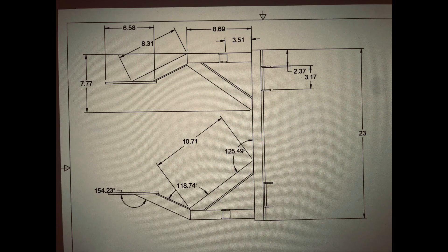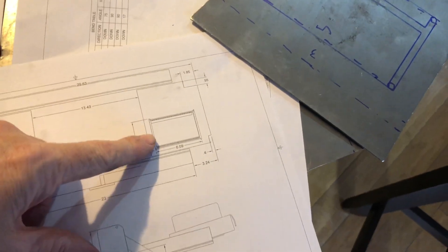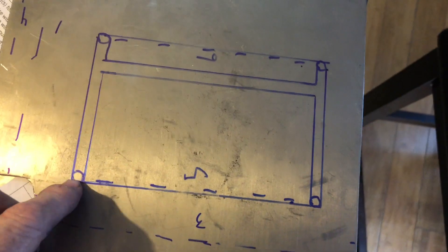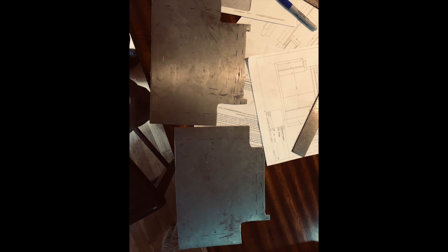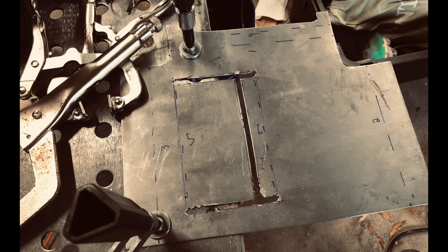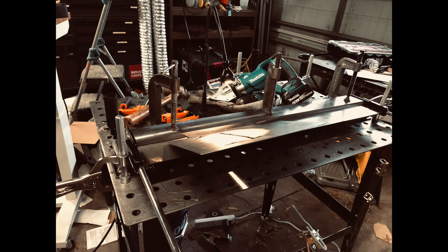Now I'm working on the rear harness for the OneWheel. In order to make the OneWheel pedal work, I've got to cut a hole out of this plate. I'm going to chain a couple of drill holes here and here. Using sheet metal I got from Home Depot or Lowe's and a metal cutting shear, I was able to cut the slots out for the front part of the harness. I made the bends I needed for the rear part of the harness, and that fits good.